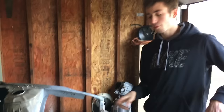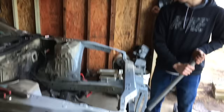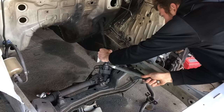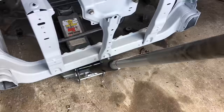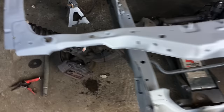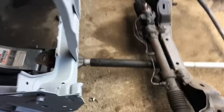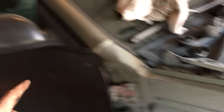We got the ball joints out on both sides — they're pretty bent out. I'm hoping it just slides off; if not, I have a fork thing. It was already creaking. We needed to slide it off so I got my fork, though Zach's came off pretty easy. Got it out — just had to tap with a hammer and split the splines a little bit with a flat head. Now we just pick up the coilover and slide it forward. Go ahead and put it down, lean the coilover in. The subframe is out of the car — it's actually so heavy in the back, I had to put tires under it because it was trying to do a wheelie.